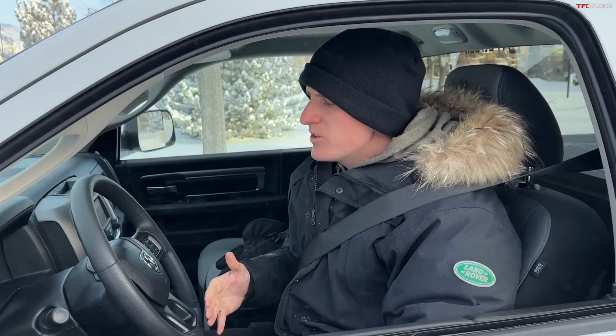Well, what do you think? Well, so with traction control on, I got pretty stuck. With traction control off, I got enough wheel spin and I was able to get unstuck. Now, I was trying to be very gentle on the accelerator to get the most traction possible, but that one took a little bit of a heavier foot. So let's try four-wheel drive. All right, go back.